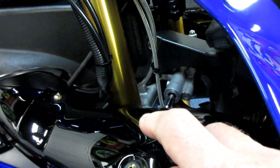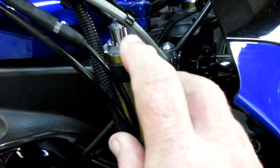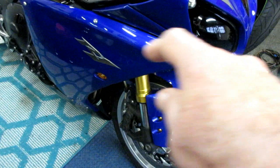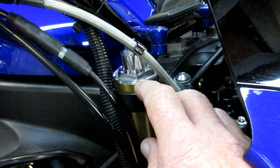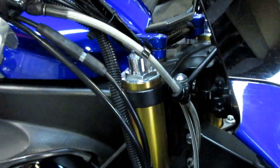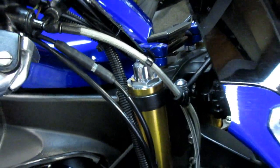An R1 has an adjustability factor — you can just loosen the bolts and slide the forks up and down any amount. The limit is whether the tire, fender, or brake lines are going to run into some kind of interference fit. The first thing I'd suggest to anyone considering this is do it a small amount. A half inch is a good place to start, three quarters of an inch. And of course, lower them both the same amount.